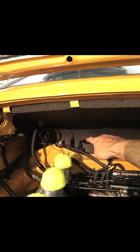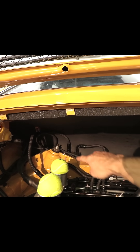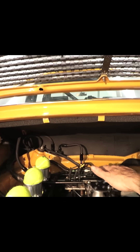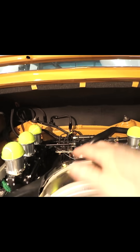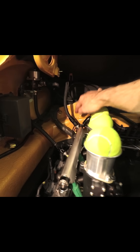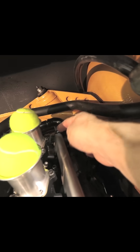The fuel comes in from the supply — straight from the tank, there is a filter underneath the car — it goes into this T-junction and splits almost even distance to the banks, left and right. Part of it goes to bank one, two, three, and the other part goes via this hard line into this fuel rail, which is four, five, six.